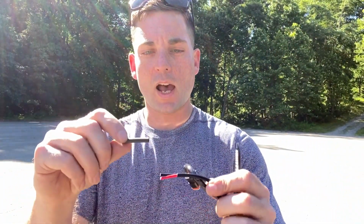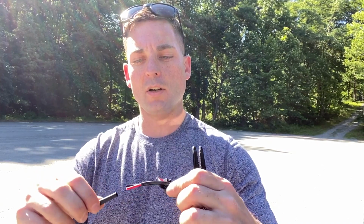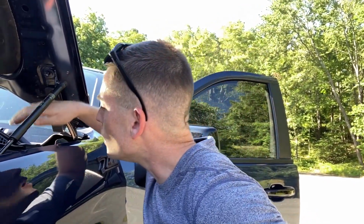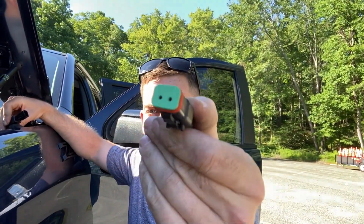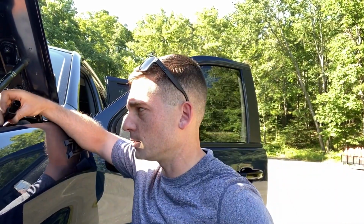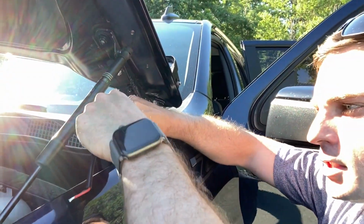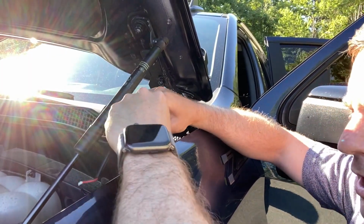And I am going to use the rubber fitting to house it, slide it on, twist them together. This is what a lot of you guys were asking me about. Slide it on, twist it together, heat it up so it just holds it together permanently, and we'll be good. So let me do the passenger side and I will demonstrate on the driver's side where the camera will give a better view. What I'm gonna do is connect the pigtail that is provided by LASFIT in the 3-inch pod packaging. And I just dropped it. And I'm gonna connect it to the pod wiring here. Pretty simple. It's shaped with the clip on one side, and the clip is right on top here. Just gotta push them together till it clips. You don't hear anything. You could actually feel the little clip.